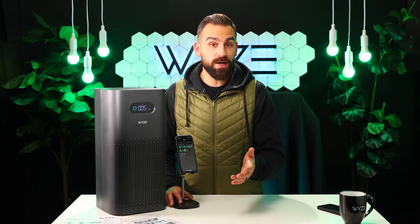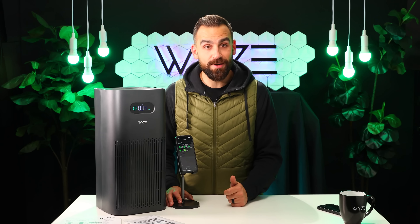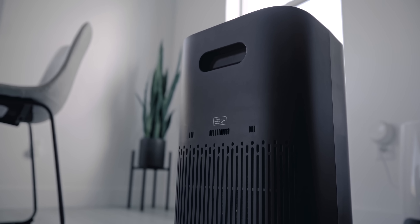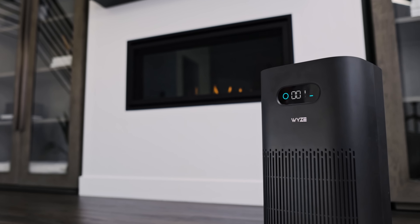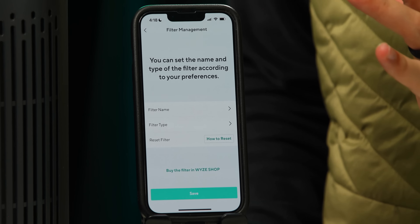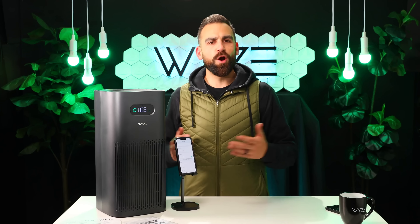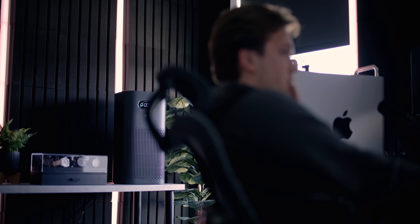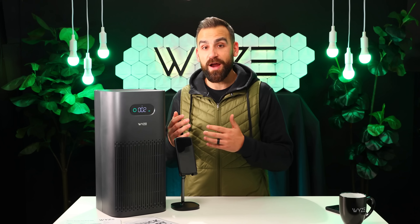Click the plus sign, go to add device, home, Wyze Air Purifier. The first thing it's going to ask you to do is prepare it to be added — we've already taken off the plastic around the filter and some other things, but there are step-by-step guides there to guide you. If the purifier isn't already in Wi-Fi pairing mode, you can place it in pairing mode by holding down the auto button and the fan button at the same time. You'll hear a sound, and then you'll see the Wi-Fi icon start to flash — that's how you know it's in pairing mode. Once it's in pairing mode, you can add it by adding your purifier to your account, click begin, and it's going to start searching for your air purifier. Next, you enter your Wi-Fi information, searching for network and connecting. Now we're going to give it a name — call it Studio — and your new air purifier is all set.